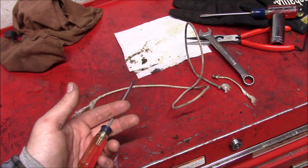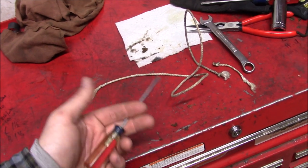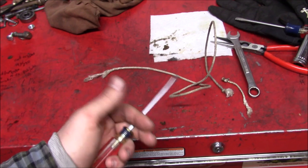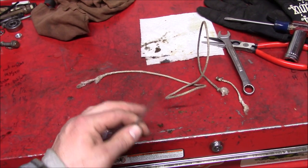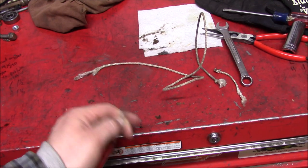And it was kind of a good contrast running the old modified 1010 up against it. And I would love to see the 1010 run as good or better than that 700. It still is going to need some tweaks. So we're going to have to work that 1010 over a little bit, try and get some more down low torque out of it, or maybe tweak the timing and some other stuff on it to try and get it to run a little bit better.